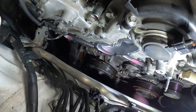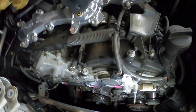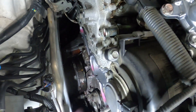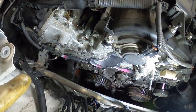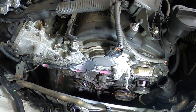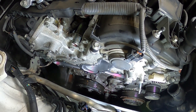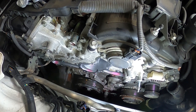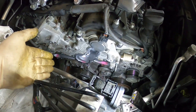I'm going to clean it up, put the gasket, put the water pump on, put the two tensioners back on, get the water pump pulley back on, go ahead and get this bracket in. Once I get that bracket in, everything should be done up here. I'll put the belt back on with it like this and put it all back together. You do have to jack the engine up and bust the two motor mounts loose. This one is a little bit easier because the plastic thermostat housing is different than the original one, but still plastic does not belong on cars. This job has been taking me most of the morning with filming in between. That's basically how you get the water pump off of one of these cars.